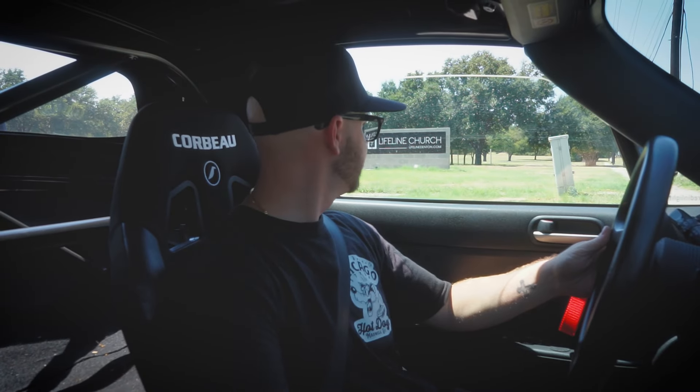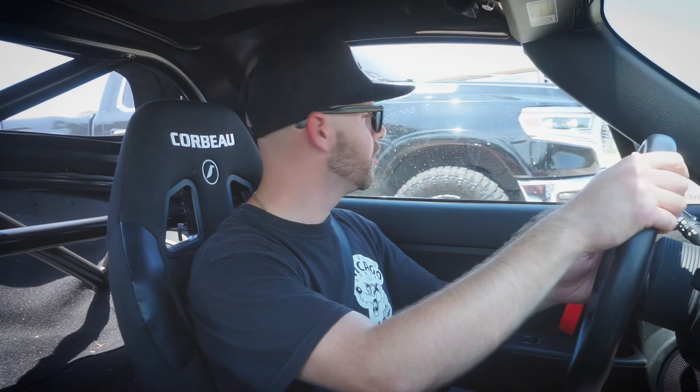The car started giving me an attitude — I had the battery charged up and it sits on a trickle charger. The last battery I had got annihilated in the heat. I went to go fire it up for this test drive. Battery was full, turned the key on, primed the engine just fine, but the moment I tried to start it it would click and everything would go dead. I reset the battery and tried again, then tightened down a few grounds that were a little loose — the two wires in my fuse box. With the charger plugged in it started up, so I'm not entirely sure what's going on.